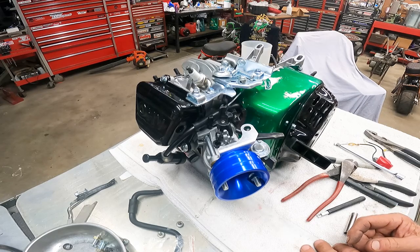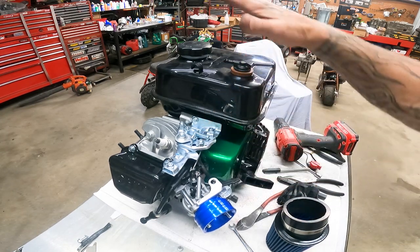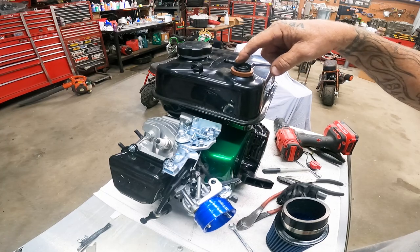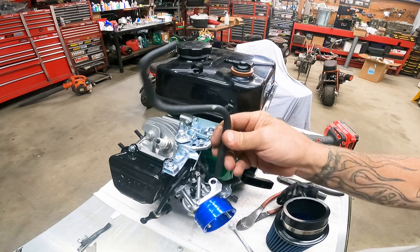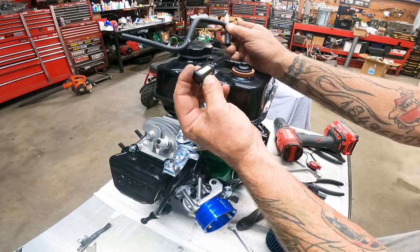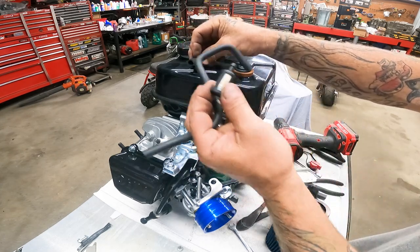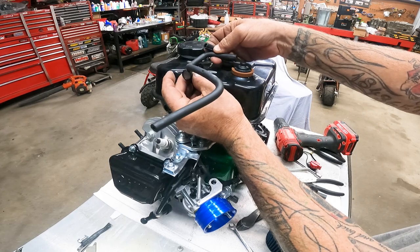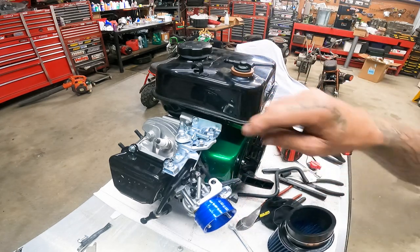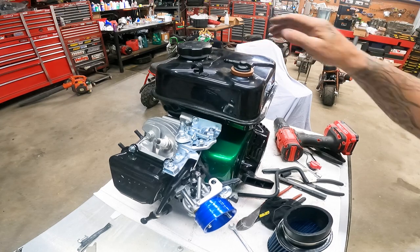I went ahead and put a return spring on there and got the gas tank mounted. We need to vent the gas cap — going to repurpose some of this emission control line that was already on here and re-cut it down. We're going to put a filter on it — this is just an inline fuel filter that works great as a tank breather. I'm going to cut this and see if we can put that filter right there — I think that'll look nice and neat. Got the air filter and the sock to put on. Going to plug up this exhaust so nothing gets in it. Get the air filter on and I think we'll call it a wrap for tonight.